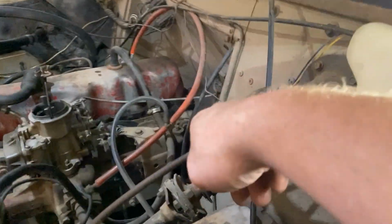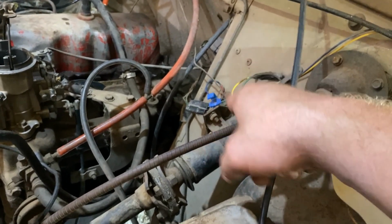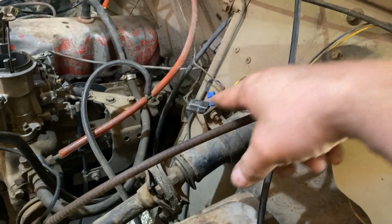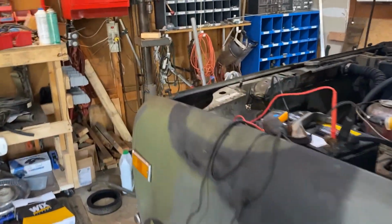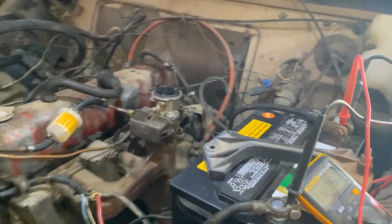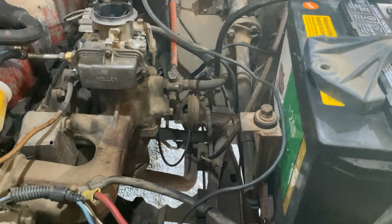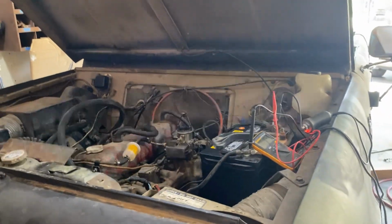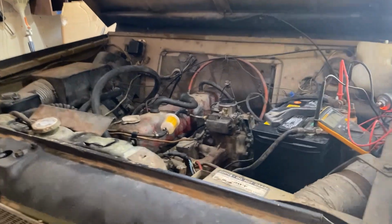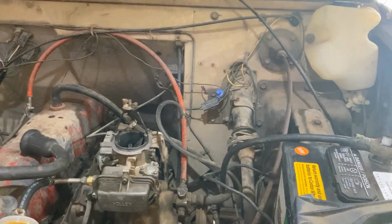Yeah, buddy. So I knew that wire is going to the ignition switch. It's got a bad connection or cut, whatever, between here and there or wherever. So, shut this off, it's loud. So there, I feel dang good. I figured that out. Hot dog, baby, I love it. So I'll fix that wire or replace it or whatever, and give it a whirl, and the charging system, knock on wood, hopefully it works. I mean, like I said, the wiring in this thing is immaculate, but at least, hey, they soldered connections, right? So, all right, let's get it fixed and get that done.